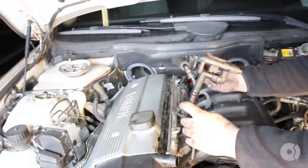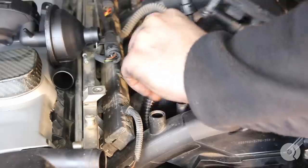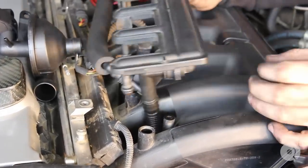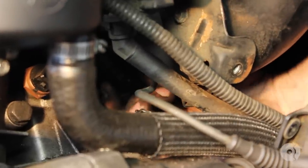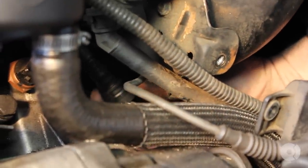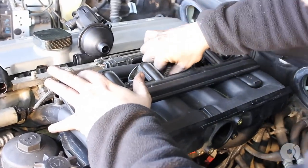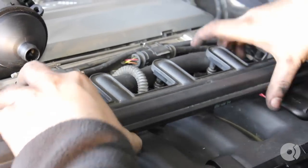What I'm going to do now is take this flexible hose and slide it down into position. You can see it just kind of slides down there. I'm going to grab the hose and spin it around so it's facing where the valve will be — that's the orientation you're going to want. Remember to reconnect the air intake temperature sensor at this time — when you hear the click, you know it's all the way in.